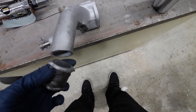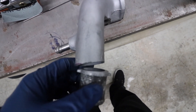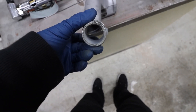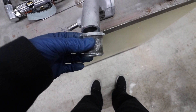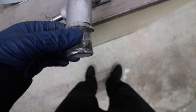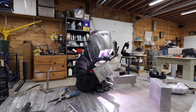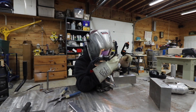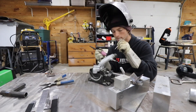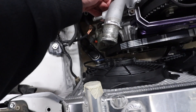I got this water neck sitting pretty much exactly where I want it, so I'm gonna hit it with a grinder or put it on the sander and try to just barely notch that out a little bit so I can have this thing shooting flat or maybe slightly down instead of straight up. Then I'll tack it up and put it on the car to see how it looks. Hopefully that'll work pretty good — it's basically just a straight run, so that should work fine.